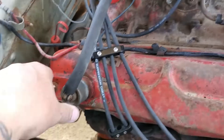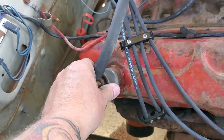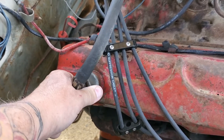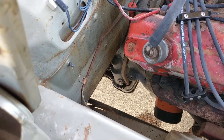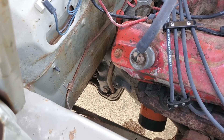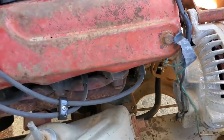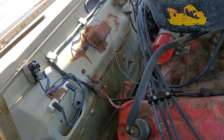It's got a weird PCV valve on this thing — it's all built in. I've been looking online and you can find the retro ones but they're kind of a small fortune. So I did some searching and they make a rubber grommet that replaces that, and then you just put a newer PCV valve in there — that stuff should be here in a couple days. Also got a new voltage regulator coming — I crossed the alternator and the ground and it seems to charge, so we figure it's the voltage regulator. That should be here in a couple days as well.